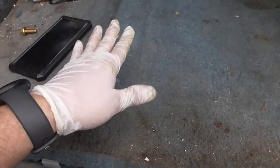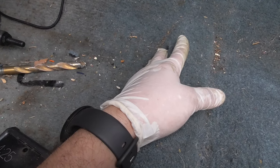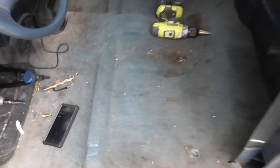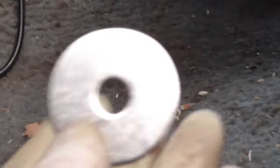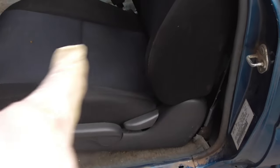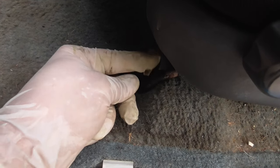It's going to have a solid mount here and two mounts back here right into the body. I can come back at a later date, shave this rib nut off, and actually put a bigger rib nut in there, or nut the bolt and weld the bolt to the back side. I'm going to use my welder today anyway because I've got to extend the mounts. There's the bolt in that side with the flat washer. I ended up having to elongate the holes just a little bit — about an eighth inch — and I did the same to the other side.